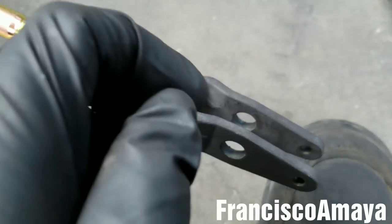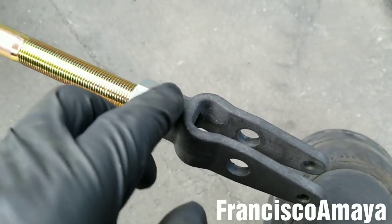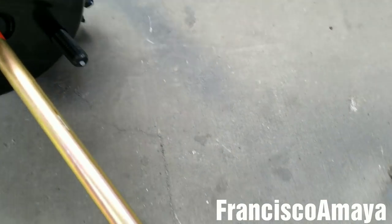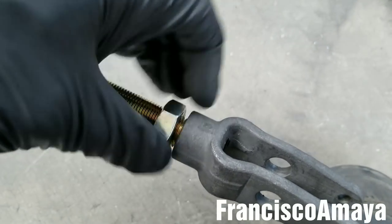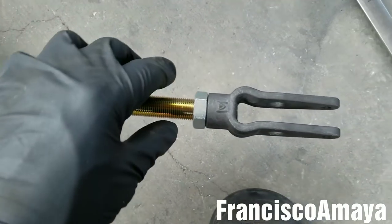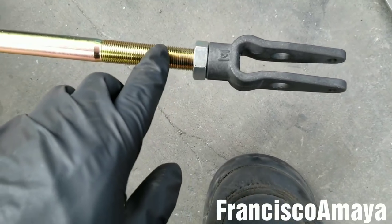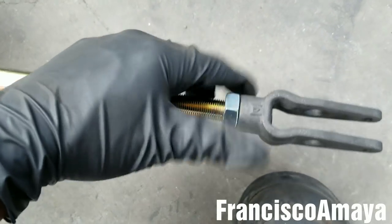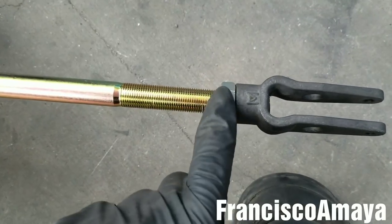Re-measure to confirm the right length of the pushing rod, then re-measure this new one to match. The pushing rod length is correct now — I've cut it and positioned it in the right place, so the brake chamber is ready for installation. Remember to tighten this lock nut that secures the clevis — tighten it really tight because this is very important.